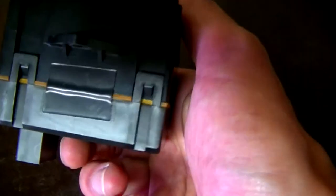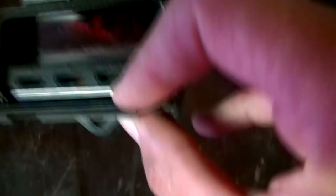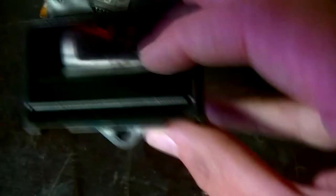I have the clock removed — this is what you end up with, just a small little piece of plastic. What you want to do is release the tabs — there's two on the top and two on the bottom — and you have to press the lip up so you can separate the two halves. When you separate the two parts, be very careful because there are four plastic pieces that will fall right out of these holes. Those are the buttons to set the time and activate the clock. You have to put those back, but I will show you how.